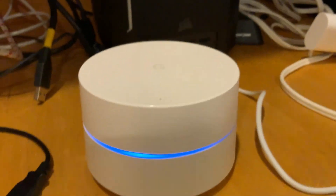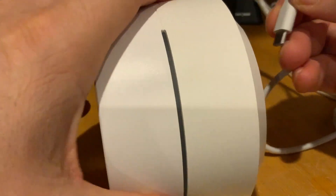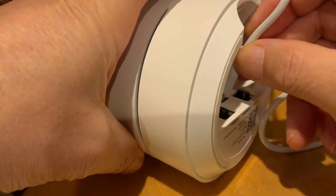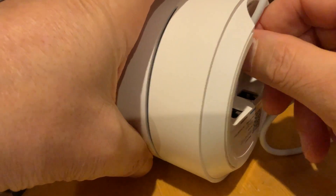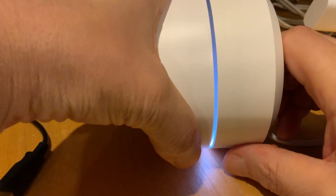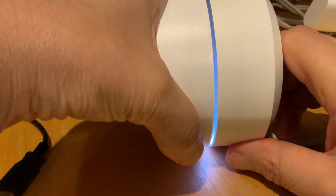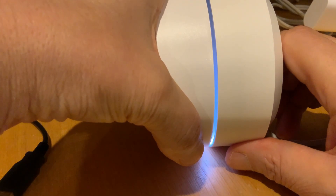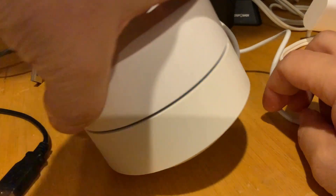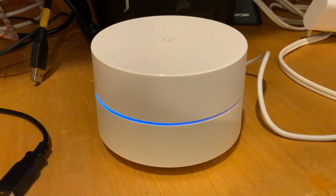I'm going to try again with this one. Unplug, hold the button down — I like to hold it for 10 seconds before I plug it in. It should be about 10 seconds before it starts to flash blue. Again, it'll either be an amber pulse or a blue pulse — I got a blue pulse, so now let go of the button. The blue pulse means the software reset I did didn't take.